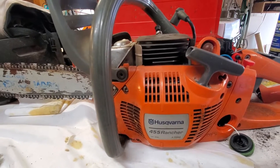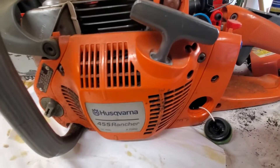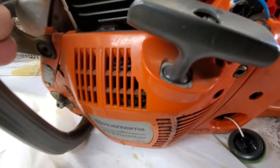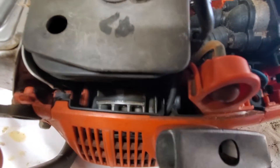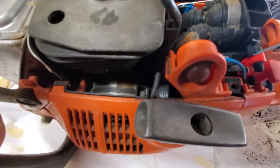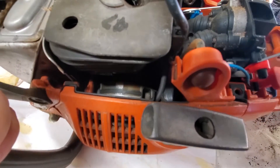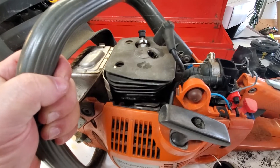But man, I've just got a mess out here, so I'll carry on with it. It's very simple with these kits — a novice person can do this. You don't have to be adjusting things or anything to make your saw run well most of the time. The only other maintenance I know I'm going to do: if you can see down on what I'm going to call a stator — I don't know the right term, but that area around there with the electromagnetic that turns to create the electrical pulse — that looks a little dirty to me, and I always clean those. Should be better running and better starting with that too. Just some simple seasonal maintenance. Take care of your saw, love it like it's your own. Have a good day.